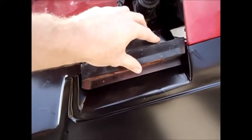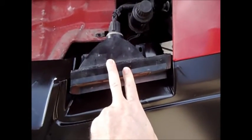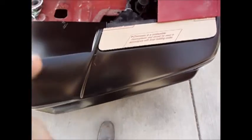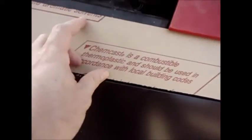Remember, there's a lot of thick primer and that's going to smooth all that out. Put the screws in, take your plexi covers, put the tape around there — 3M tape all the way around the border — put them down. So there are the covers in. Again, they don't fit too good because they were made for the other 2-3Cs, and I trimmed that out a little bit — less than a quarter of an inch — but it's enough for it to not fit perfectly.